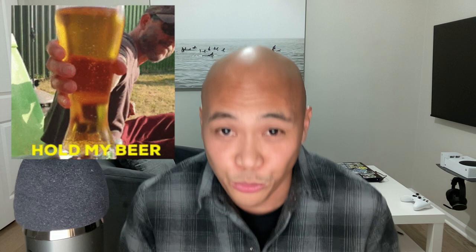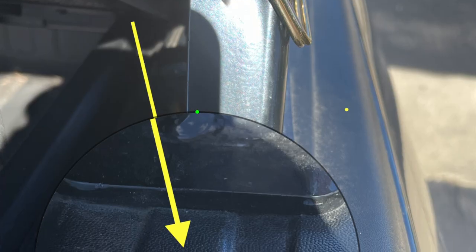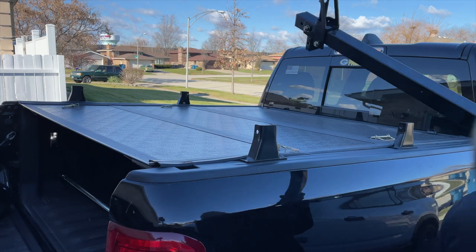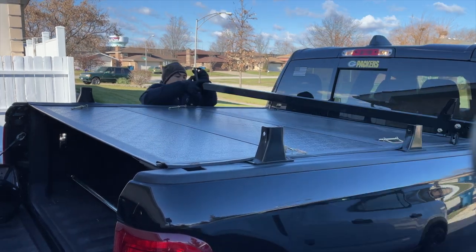Now that you have identified the measurements, it's time to drill holes. On the bed rails of your truck you'll see grooves — you will want to drill here, not here, here. Make sure you measure both sides and mark it with a sharpie. Always remember to measure twice and drill once. Now it's time to mount the brackets — it should look like this. Then install the bars. These bars mount with pins instead of screws, which makes them easy to remove so you will have full access to your truck bed if you need to haul large items.